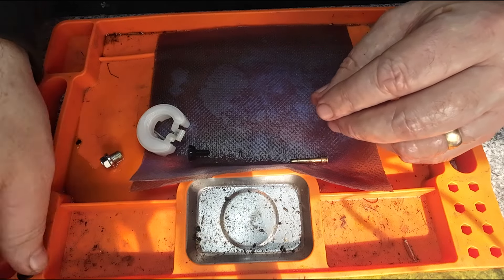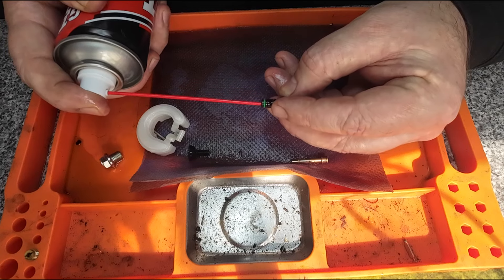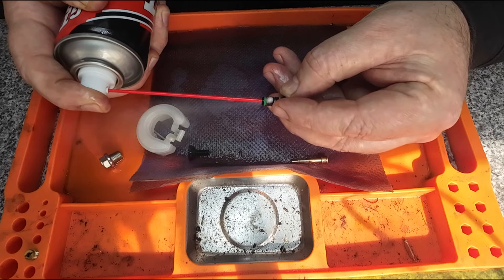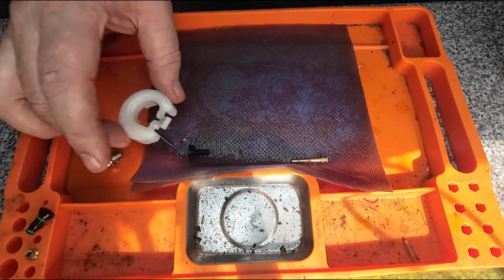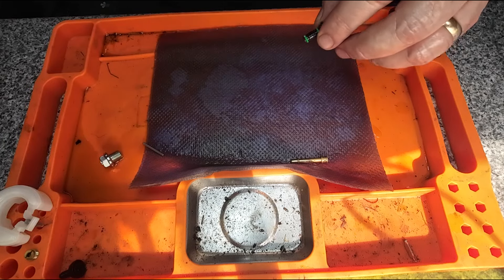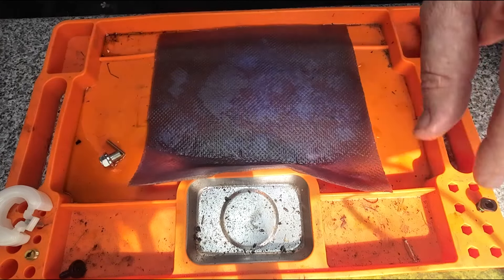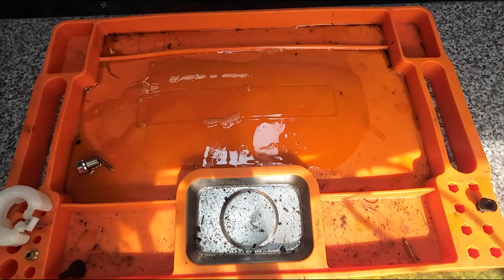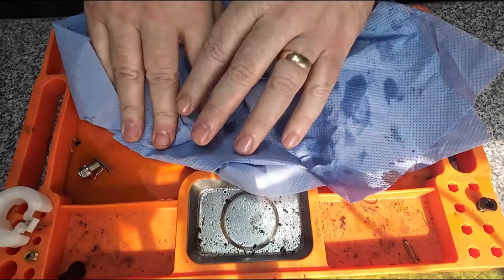I'm going to spray the rest off. The last one to do is this slow idle circuit — there's a little tiny jet inside here. Put the straw in and give it a bit of a spray, and I can see it's moving through as it should. It could just be the fuel itself which is old and tired and needed fresher fuel. These trays, incidentally — if you want one, find them on Amazon or eBay, just put in 'carburetor cleaning silicone tray' — they're about 20 quid. I like them because you can put all the bits in there and don't lose anything.